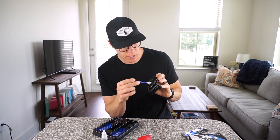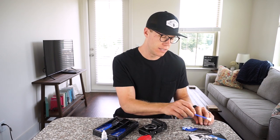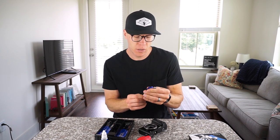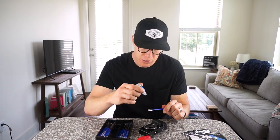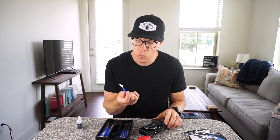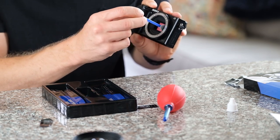If you don't have any dust remaining after the dry swab pass, you don't have to use the solution. I still have a tiny dust spot on my sensor, so I'm going to discard this swab. The reason you discard it is because any dust or sand from the sensor is now on this swab — you don't want to reuse it and scratch the sensor. Get out a whole new cleaning swab and put two drops of solution on it.